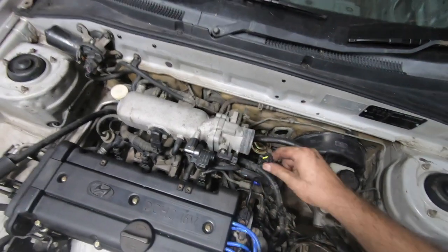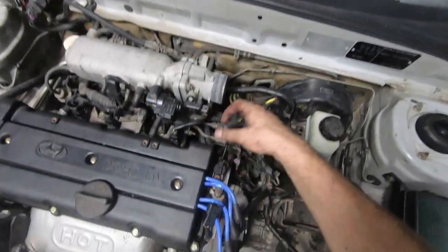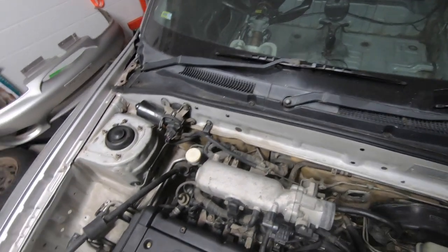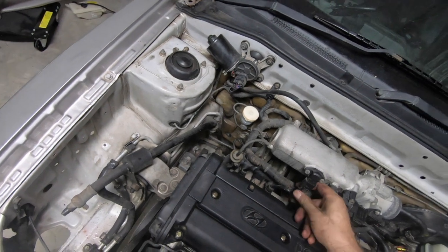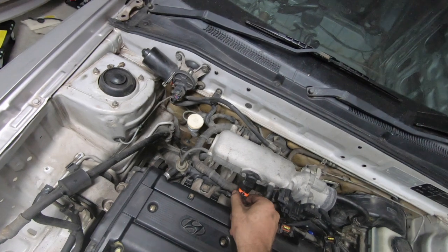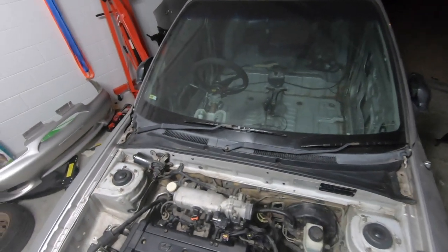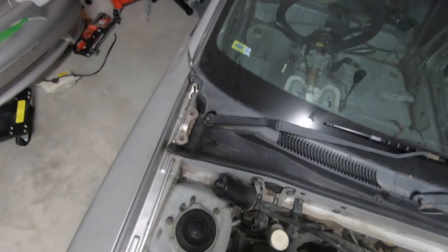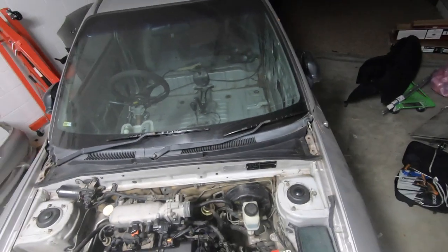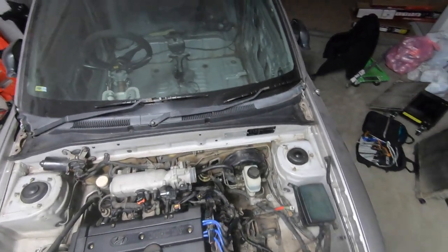Now you slide your connection off, and there's those two connections of the wiring loom done. Then you move on to your injectors, do those ones, and then this one here, gently, without breaking it, it pops off there nicely. You just keep moving along the line, making sure you're disconnecting everything off the engine and the transaxle, ready to pluck the engine out. So we'll continue on with this and see how much further we can get.